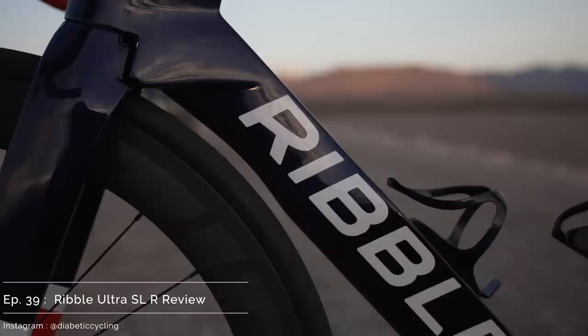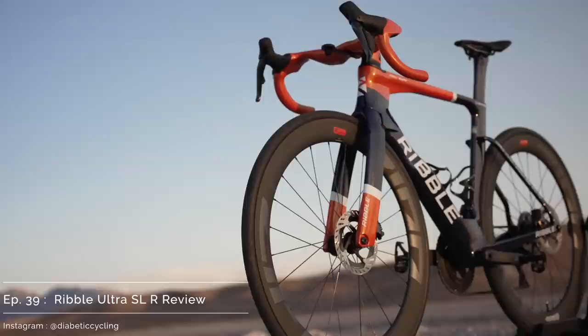The down tube also has a similar design cue where the top section of the down tube has a slight cutout for the front wheel to again move back a bit towards the center of the bike, which creates a very aggressive stance because your wheelbase is somewhat shorter, and it also creates a smoother transition of the airflow from the wheel and tire combination.